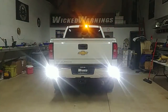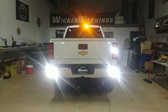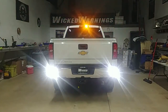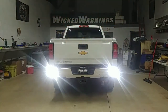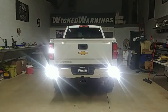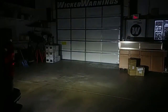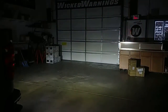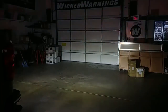The other request on this job was a little bit of rear illumination. This particular truck is involved in snow removal duties, so it's often needed to light up the area it's working in. We have some Baja S1 LED floodlights underneath the tailgate there in the step pocket in white. That's a nice, simple, effective floodlight. I went with the wide fog pattern on the lens, which gives a nice even dispersion of light across a wide horizontal axis — it does a real good job lighting up all over behind the vehicle.